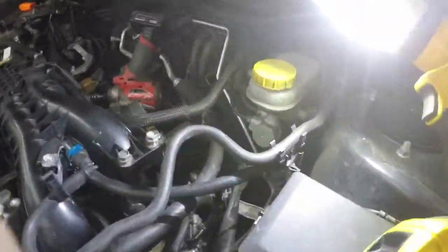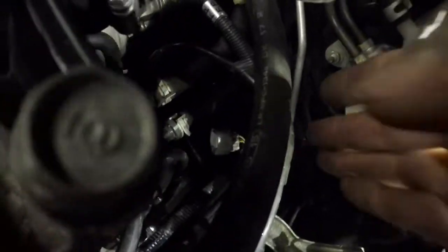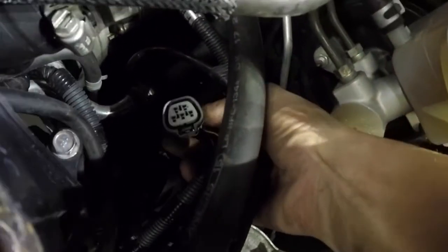Where do I have the plugs somewhere for the TGV? Where is the TGV? Alright, so this I believe is the TGV plug. I'm gonna buy the plug from Subi Bros, I believe it is, that caps those. I don't know if it does anything special with it, but it basically just caps those. And then we'll be going from there. So yeah, let me knock out this EGR delete real quick.